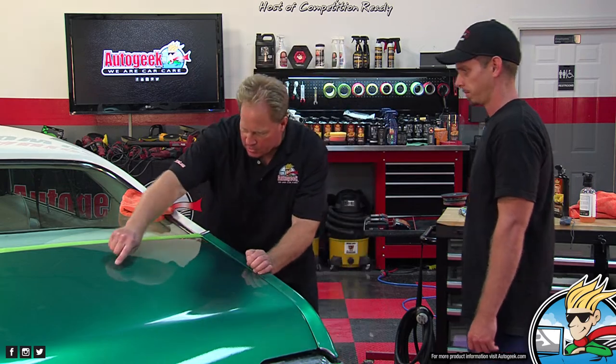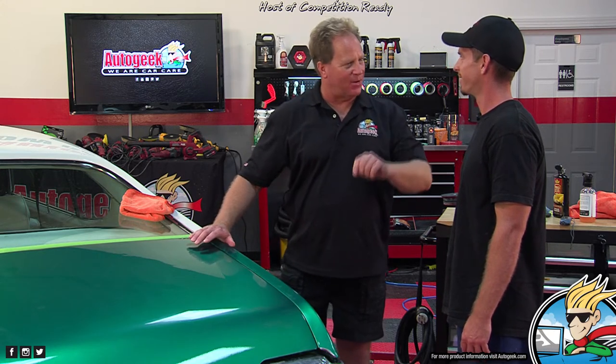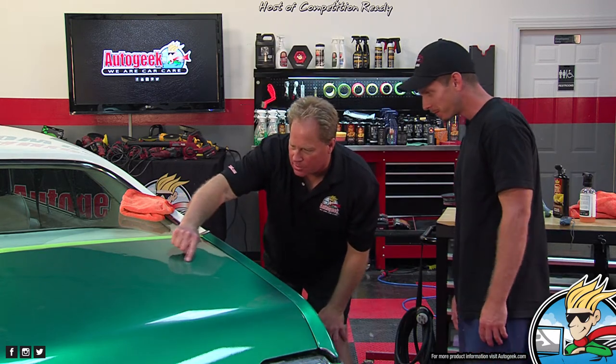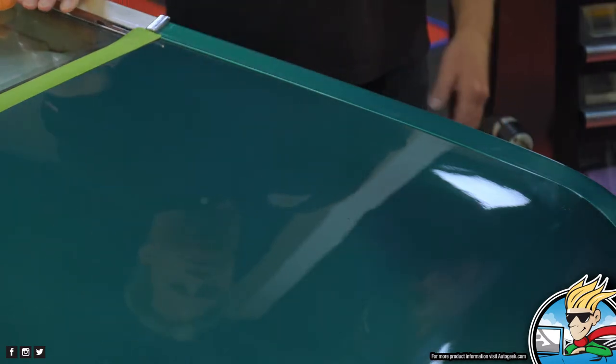Now, remember the high spot? Look how that's smoothed over. We still see where it's at. Now, when you leave here and you have all these skill sets, you can go home and try to knock it down even flatter. And then if you do a great job, hey, it's your chance to go from zero to hero. But if you go through, then you get to tell the wife you're getting the trunk lid repainted. Oh, yeah, by the way, honey. Remember the pigtails? You can still see some of the pigtails right in there, very light. They're not pronounced like they were before.